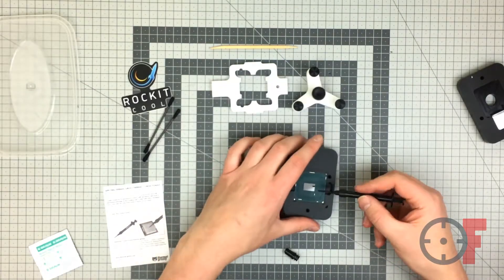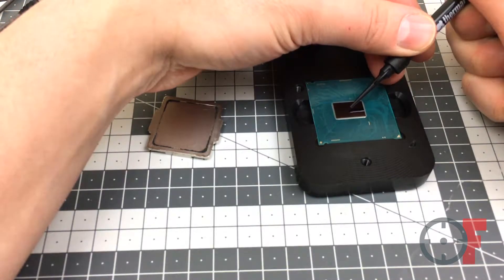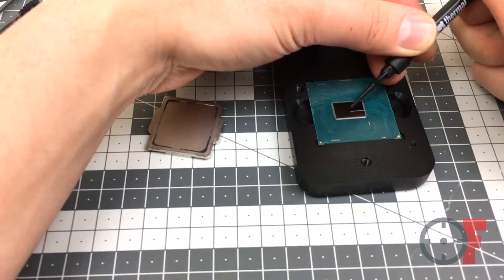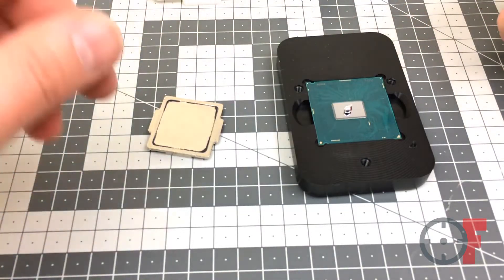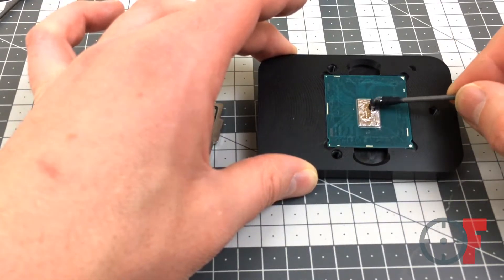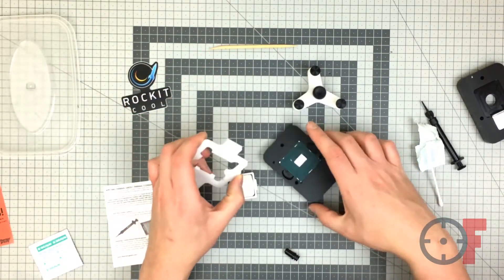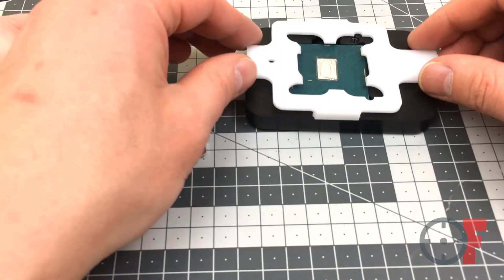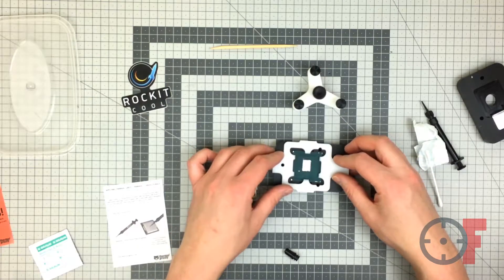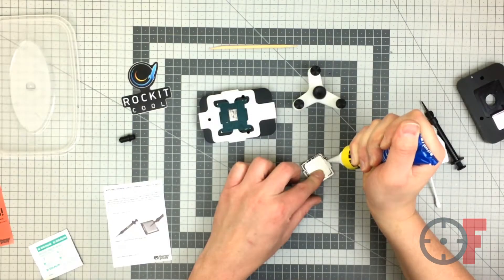You really don't need a lot of this liquid metal compound, but I'm pretty heavy-handed, so I probably used at least half of whatever was in the tube, and I had to remove some of that. When I was done, I used the alignment tool, which allowed me to place the heat spreader exactly the way it was before the delidding. Just remember to make sure that all the little engravings of your model are not upside down.